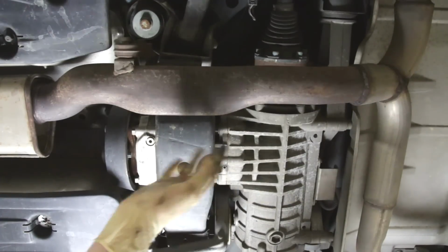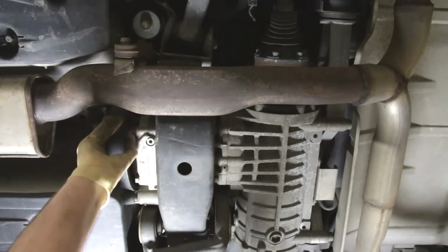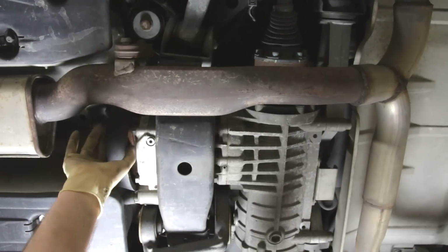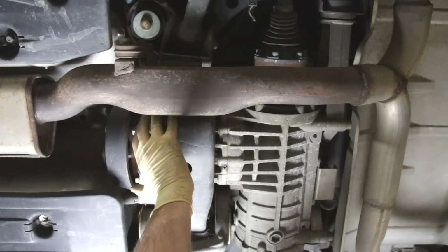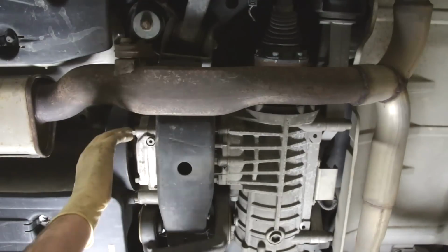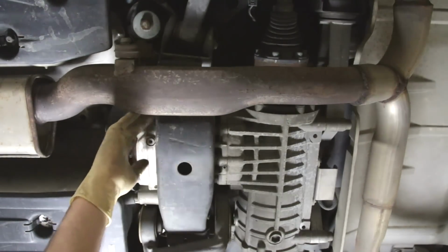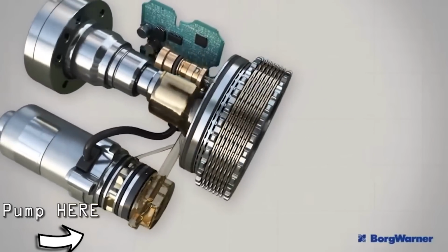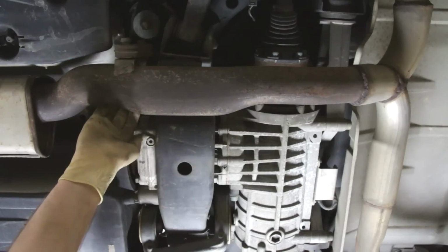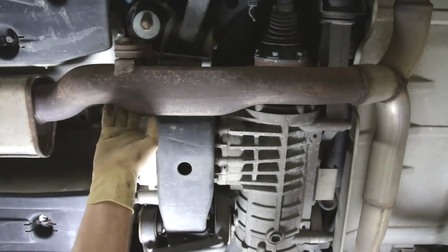Okay, here we are looking at a rear differential. Here is the drive shaft, and then here's a coupler here between the front, obviously front and rear, and you have the Haldex unit, which is in here in the front, and this is what controls engaging and disengaging of rear-wheel drive. If you're not familiar with how Haldex works, we have a video that we will link to in the description to explain that. You would service it. There's a drain plug here. There's another plug there. We will at some point have a DIY going over this whole process.